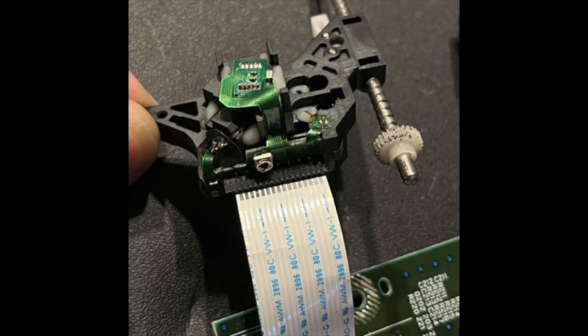That's essentially our last modification. Now reassemble your GD-ROM drive — reconnect your wires, get everything back inside the enclosure, and put it back in your console by reversing the steps you took. At this point you should be able to test everything and see if games work. If games work, you're good to go — no further adjustments needed. If CDs work but original GD-ROMs don't, or nothing works, you may need to adjust the pot screw shown on screen right above the ribbon cable. Make very small adjustments — test first, then make little turns to the right if your games don't read right away. Outside of that, you should have a working Dreamcast.